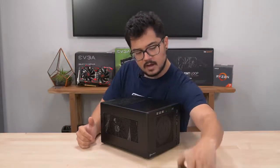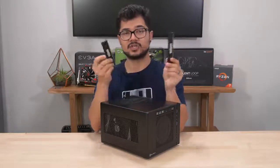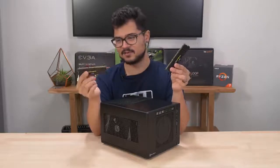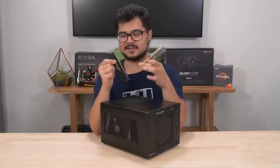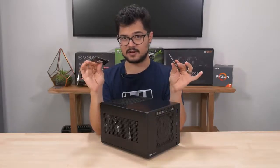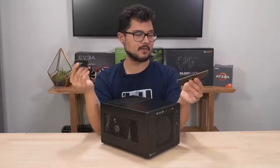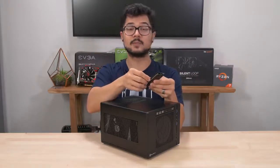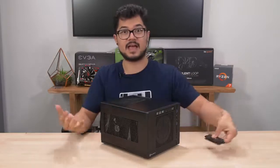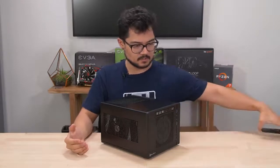So we are going to be upgrading that memory kit to this 16 gigabyte kit of Vengeance LP non-X. This is DDR3. This is before the X came around, just a standard low profile. It's still got the green PCBs and all that. Now we are taking a slight speed hit here, going from 2400 to 1866. However, I'm okay with that because it's not going to affect our gaming performance much compared to what we might incur if we had too little RAM in our gaming system. So very excited to be swapping that out today.